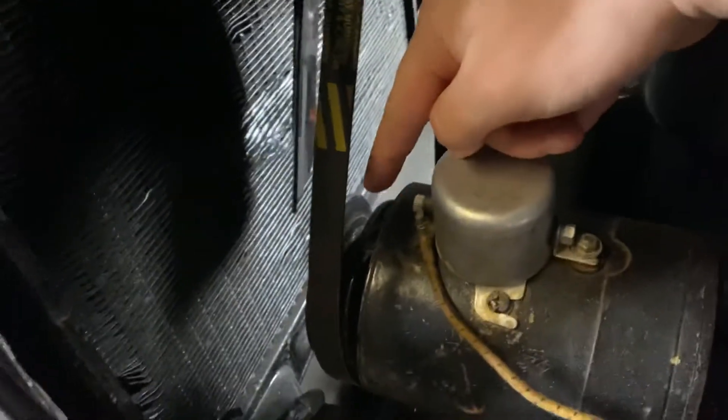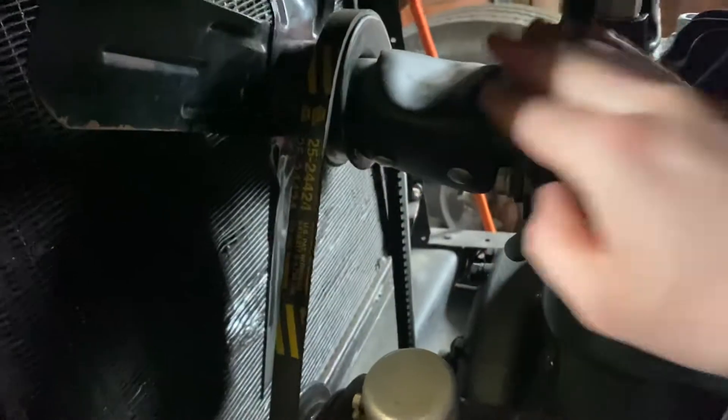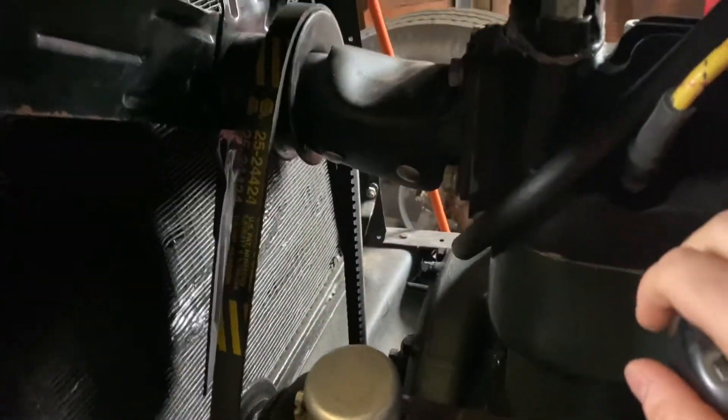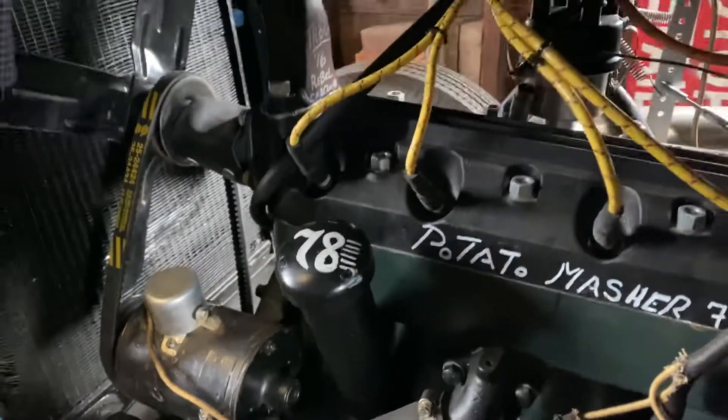So this works the same way — the power pulley comes from the crankshaft, that causes the rotation, makes the belt turn, makes the generator and the fan turn. This also powers the water pump, which circulates water from the radiator into the engine so it cools the water off, puts it back inside the engine, and allows it to cool. So that is belt and pulley.